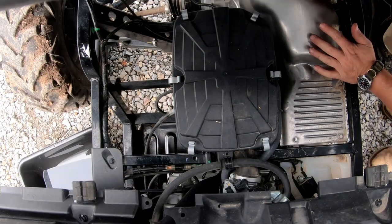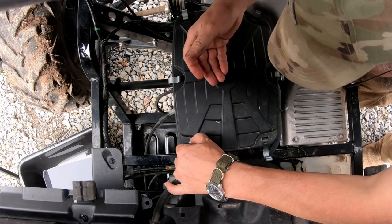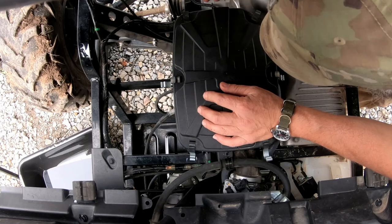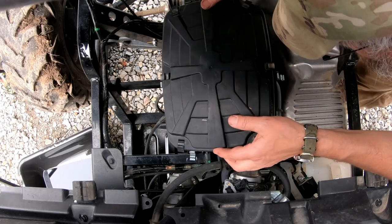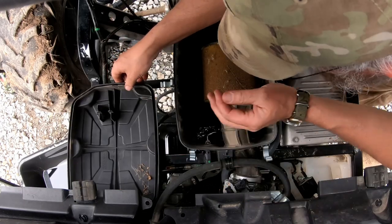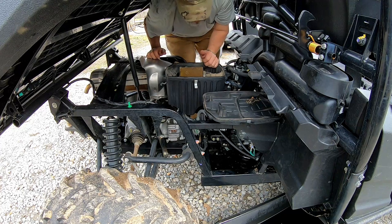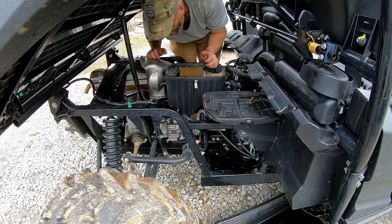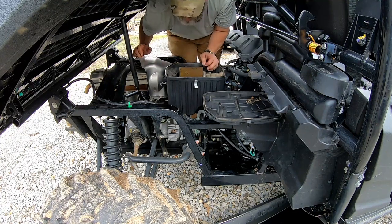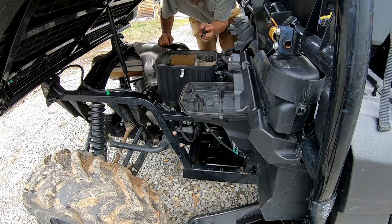The last thing I need to check is the air filter. This is your air filter housing and there's your fuel injection unit. You just pop the spring clips off, pull the lid off, and see what kind of treasures are inside. There's a lot of treasures in there. It's really not too bad as dusty as it is out here. The screw clamp on here is a 6mm head if you don't want to fight with a Phillips screwdriver.